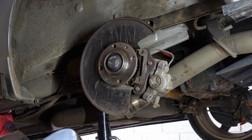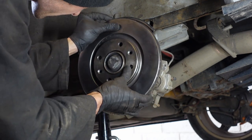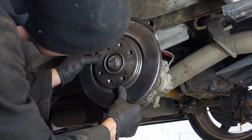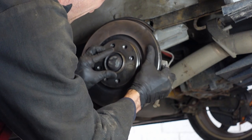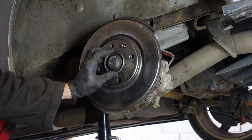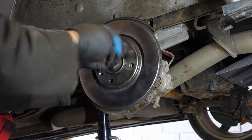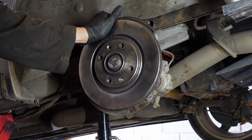They're basically M6 bolts — they've just got the fluted or chamfered edge to sit in the disc. And here comes the rain. The discs are machined to fit, supposedly — and they are machine fit, which is quite a tight fit. I'm going to get that screw on there and then hopefully we can tap it home. I've already done the other side, which obviously you can't see, but it did fit alright — the disc did fit a little bit easier on that side, admittedly. It is just machine fit, that's all.